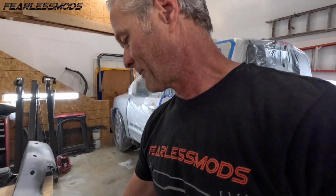When it comes to our clear coat, I went from the fast activator to a medium activator, which is good from 65 to 85 degrees, and we're right in the sweet spot in the middle of that. So hopefully we'll have some better results with it this time, but I'm really excited to get this bumper added to it and really be completely done, because it's the only thing that hasn't gone silver yet, and the repair looks great. I can't wait to see the finished product.